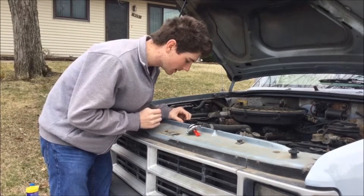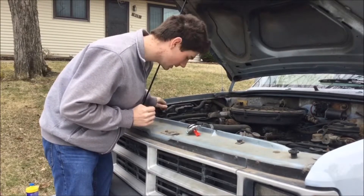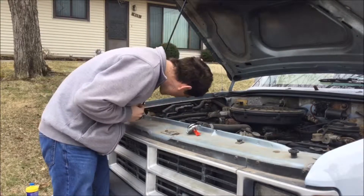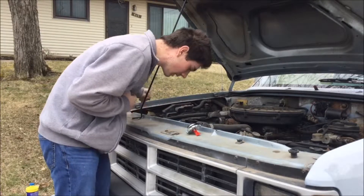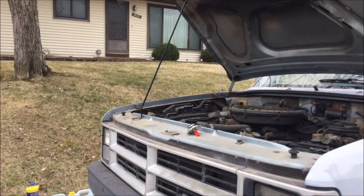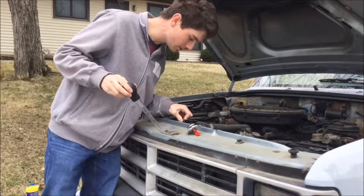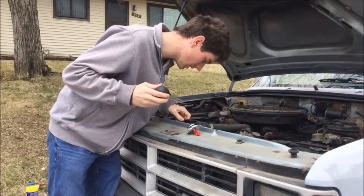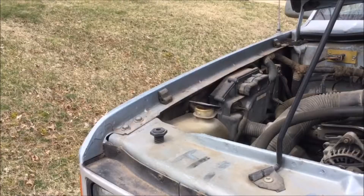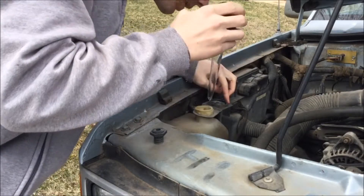Something that I did happen to think about — there is this reservoir over here for the coolant. It's the reservoir in case the radiator overflows, which just has this hose right here. You want to drain that too. So I'm going to take this hose off the radiator, run it down underneath the car, siphon it out with this turkey baster, and get it into the pan with the rest of the antifreeze. The hose is so delicate I don't want to break it. Never mind, the hose came off — I'll just do it that way.